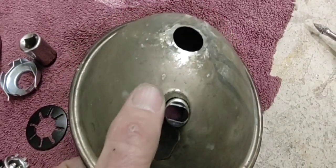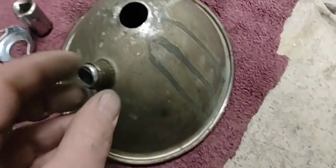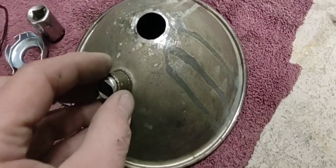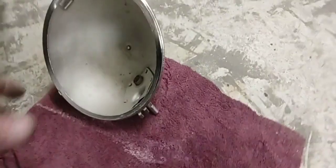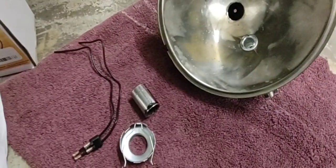And then I'll solder it around there. So I believe I have to put a ground on this bucket. I'll probably solder a ground onto there. But I'll solder this around here so it won't move around. Make sure it's nice and square in there. So they fit in there. But the only deal I see is they got a couple notches they line up there on the sides. Got plenty of room in the back here for the plug-in for the pigtails for the halogens.